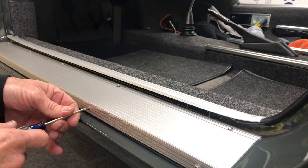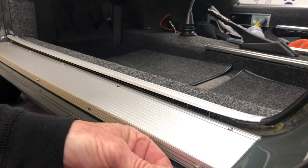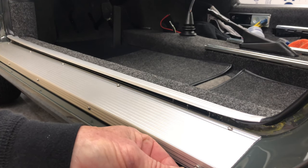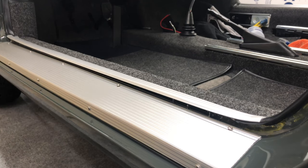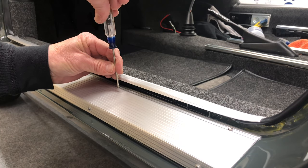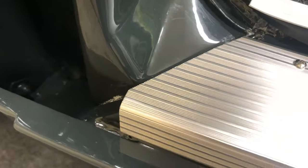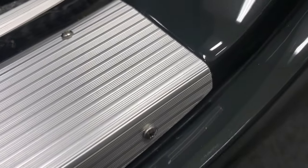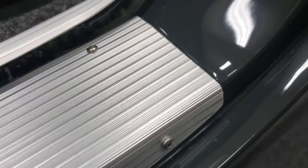Once we have all our screws into place we'll torque them down, being careful not to overdo it — stainless steel screws are very brittle. They're hard but they're brittle. Tighten everything down. A close-up look there shows just how tight everything fits in — real nice fitment from Porsche, 50 years later, right on the money. If you had too much paint buildup that could be a problem with these guys — might have to do some filing.